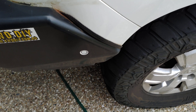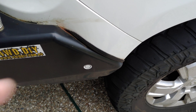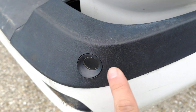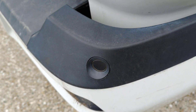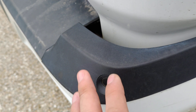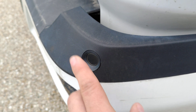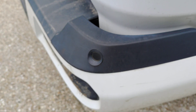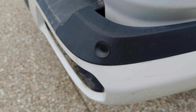When it's raining, all the rain coming down actually picks up the sheets of rain falling and causes it to pick up ghost signals. The other thing you need to do is have a look at the sensors and make sure they are clean. Every time I walk past my car I run my finger against them. If dust and dirt builds up on them, they will pick up fake readings — there's no car out there, but it picks up the dirt and thinks it's a car, and does the same with falling rain. That is why your blind spots go off when it's raining or when they're absolutely filthy.